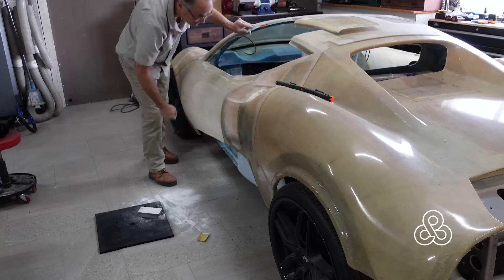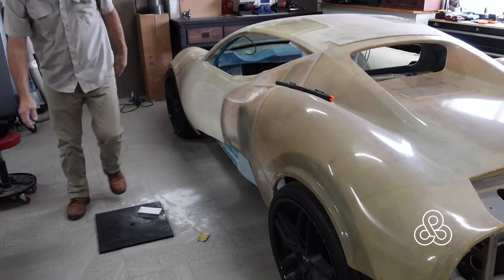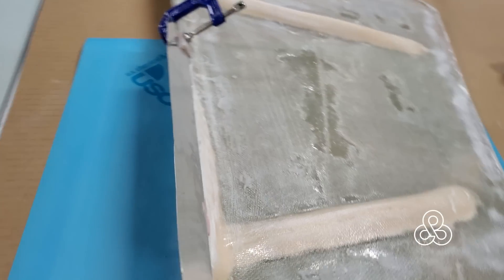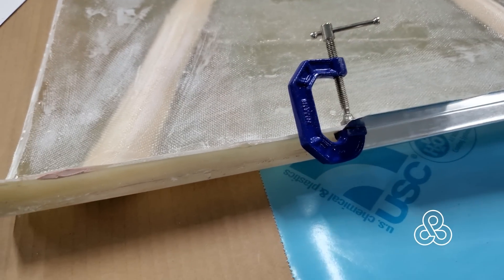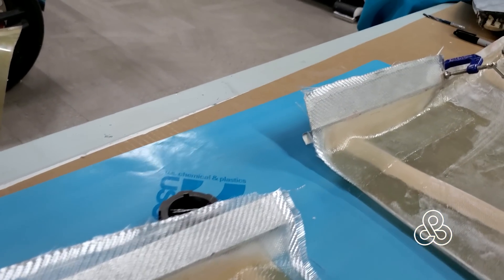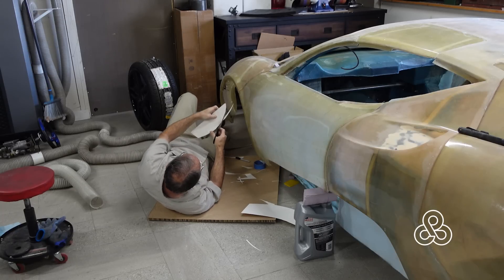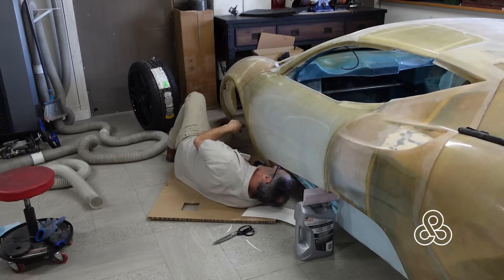I've just bent up a light gauge piece of aluminum and am going to clamp it in place on the back of that edge to create that little step back — that flange where the rubber seal is going to go — to match the existing that's already there. Once that's in place, just laminated up against it, we'll reinforce all this, trim it back nicely and fit it. That's just kind of the upper door. We're going to be working mostly in this video on the lower side of the door and where this hinge mount system is going to go.